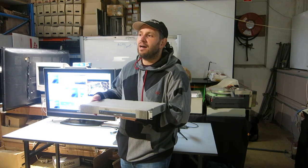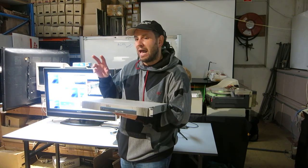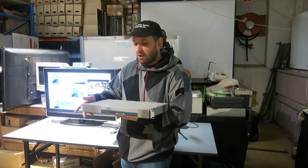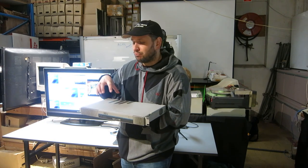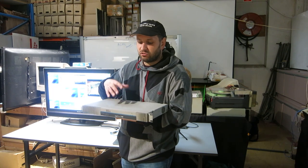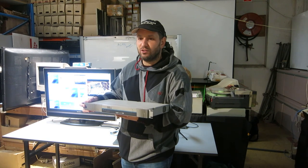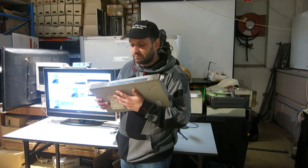It was a simple networking protocol that required very little experience or knowledge. If you were in the same AppleTalk zone — as they call them, zones — or workgroups as Microsoft called them, you would see all the other users in that workgroup, the printers, shared resources, etc. The coolest thing I've done with this was when we dialed in from an iMac on the other side of the room, we were able to print to a modern color laser photocopier from a 25-year-old computer, straight over AppleTalk over dial-up, as if the printer was sitting in the same room. I found it quite fascinating that not only is the AppleTalk stack still in use on a lot of commercial copiers, but it still works through antiquated hardware.